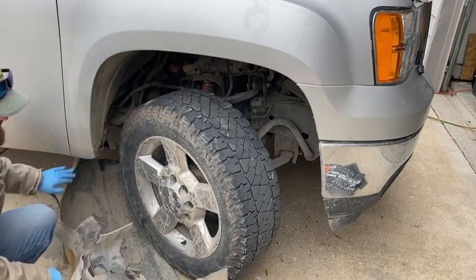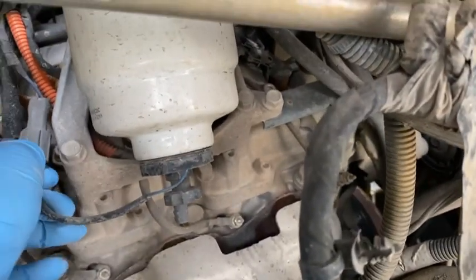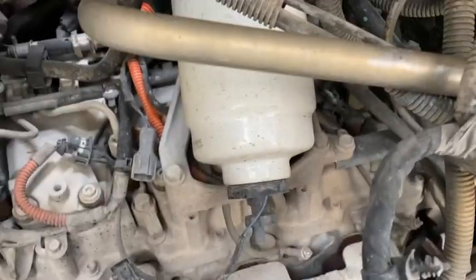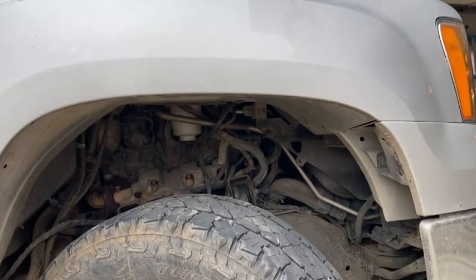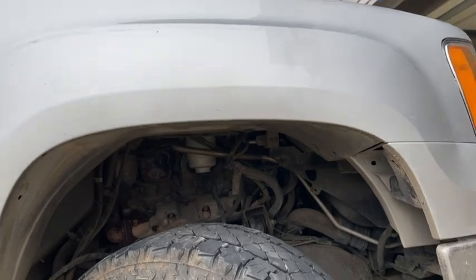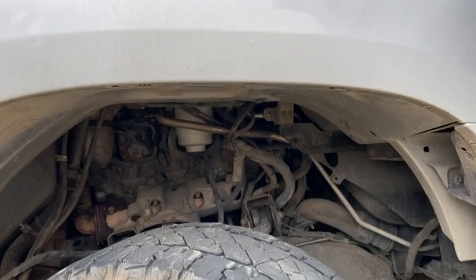I'm going to pull this off. So this is why I take it off — there is your fuel filter. That freaking easy. You have all this space, you can see what you're doing, you can reach the clip to your water separator. It's quick, fast, easy. This took me about three minutes to take my fender liner off. Yours may not have been off 400,000 times like mine has, but if you take that off, you have absolutely the easiest access in the world to that fuel filter.